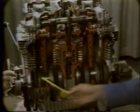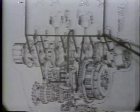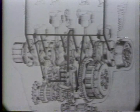One passage supplies oil to the crankshaft bearings and crank pins. Some of this oil drops directly back into the crankcase, and the rest is flung out to the piston pin, cylinder walls, and other parts, and eventually this too drains back down into the crankcase.